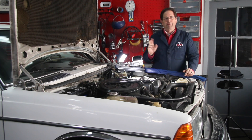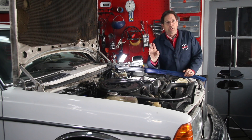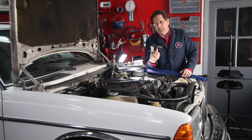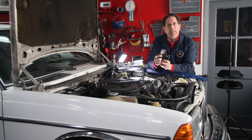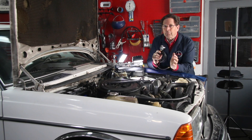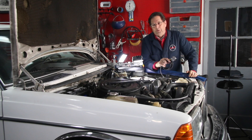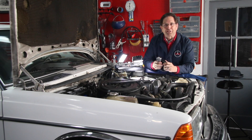At this point I'm going to let the pump go — I'm not interested in taking it off and shipping it out. What I am going to do is go after the turbocharger next. I want to make sure that turbocharger is performing properly. Later in the week I'm going to hook up this turbocharger test kit to the intake manifold, move this pressure gauge inside the cabin, and we're going to take this thing out on a road trip to find out if this turbocharger is producing adequate boost. If it is, then we're going after the Alda device and the overboost protection circuit, which can often be a problem with power. If something is really off with that, it can also create extra smoke because you're not getting adequate airflow through the engine when you need it. Hopefully before the end of the year we can find out why this diesel engine is smoking so badly.